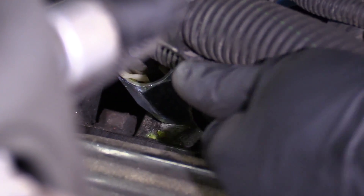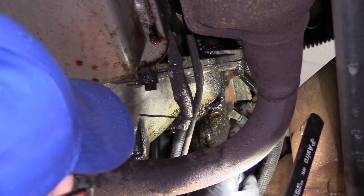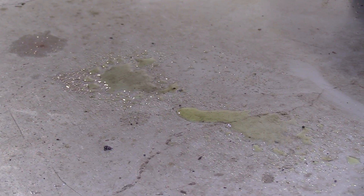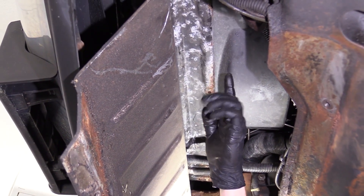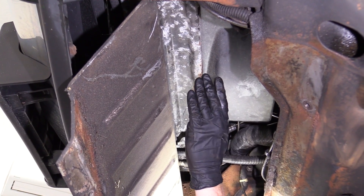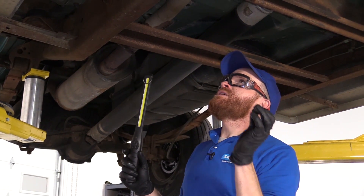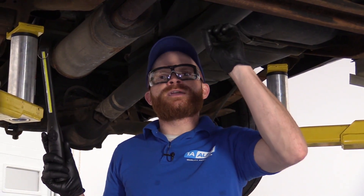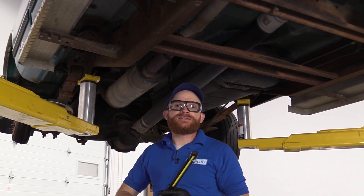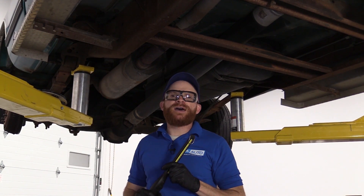This one actually looks like it's leaking as well. If you see coolant coming down the backside or sides of the engine, it's more than likely from the head gasket or potentially the intake gasket. Coolant along the front could be from the radiator or fittings and hoses connecting the radiator to the engine. On some vehicles with rear climate control, coolant tubes run from front to rear to a rear heater core. Those aluminum tubes tend to corrode, especially at connection points, and can fail over time.